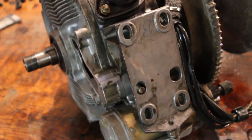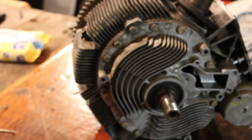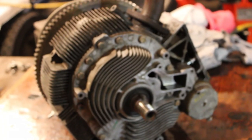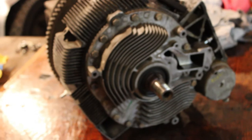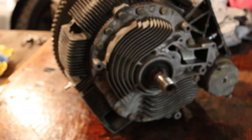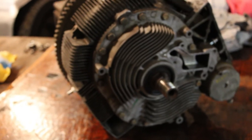We're going to open the exhaust up yet and try to get it a little more free-flowing to get some more heat out of it. Another thing I was reading says that's a good idea. Plus, this thing is like dead silent when it's running — it kind of sounds like a washing machine, which doesn't sound very cool. I'm hoping that opening up the exhaust a little bit will make it sound more throaty. I saw a video on YouTube of an old Johnson Rampage race sled — I think it was a twin rotor — and it sounds really freaking cool. I want a little bit of back pressure there yet, hopefully not run too lean and blow the engine up.